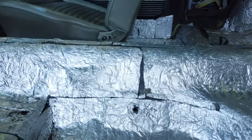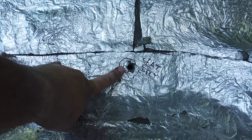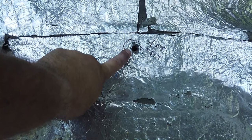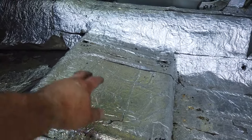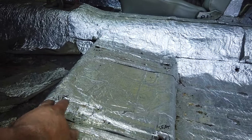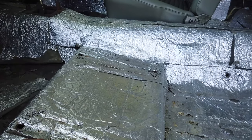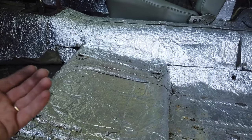So I got the driver's side front seat out and it was way too easy, because there were only two nuts on the four seat bolts — definitely not safe. The front seat bolts use a 13/16 socket on both sides. The driver's side seat came out with just one bolt and another bolt, and that was it. You need a deep socket to get those out and reach up underneath the undercarriage.